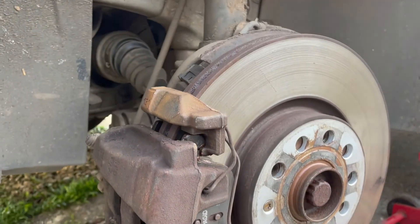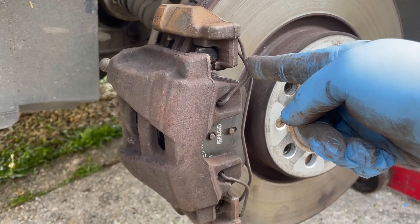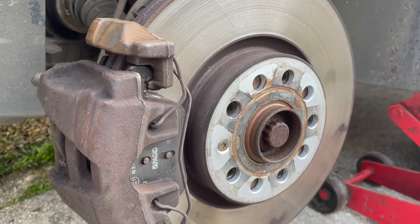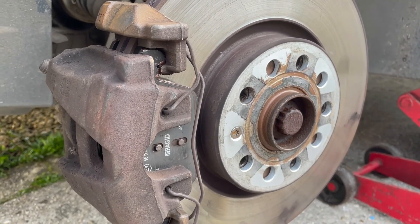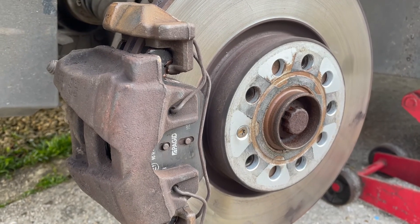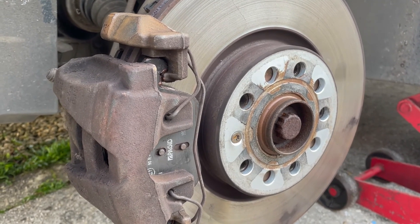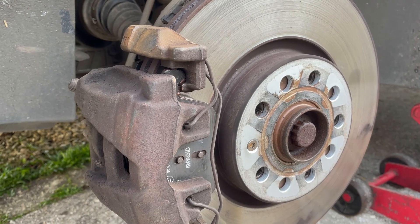To recap: we've pumped the brake pedal to restore correct clearance, the retaining clip is securely located on the front of the caliper, the slider pins are tightened with caps fitted, and we've confirmed the disc rotates freely. Always double-check your brake fluid level under the bonnet at the correct maximum height — check out another video on basic under-bonnet fluid checks for peace of mind. Thank you very much for watching — I hope this DIY brake pad maintenance was helpful. Please like, subscribe, and comment if there are any specific jobs you'd like covered.